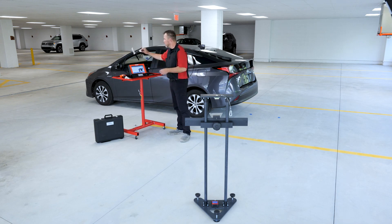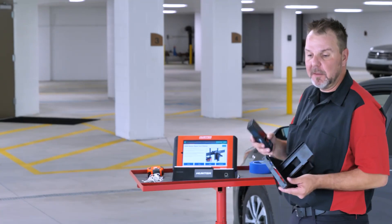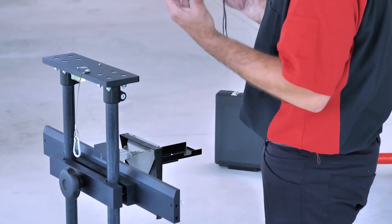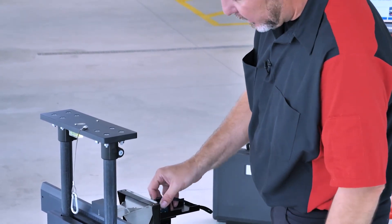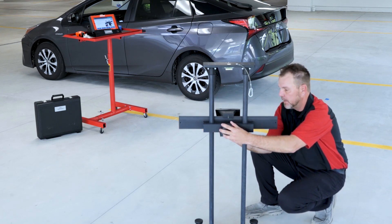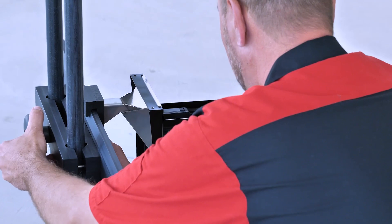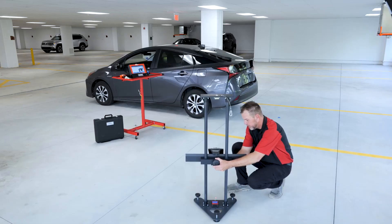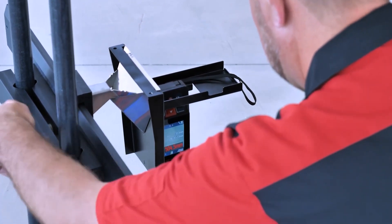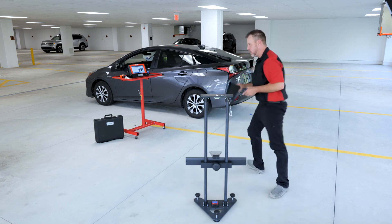My stand is leveled. I'm sitting at zero on my ruler right now. I still need to get the height on this. Now we're going to get our height using our stand and our distance laser in the vertical position. I'm going to get to 505 millimeters from the floor. This distance laser comes with each one of your ADAS Link or DAS 3000 kits — a super handy tool to use. I'm going to drop it right in here; the laser is going to point to the floor. Right now I'm showing 903, so I'm going to move this down until I get to 505 and lock it into place. Once I get it down there, I can remove my distance laser and the laser holder, leaving just the triangle reflective cube on the stand.